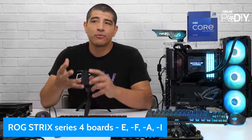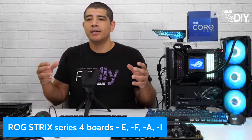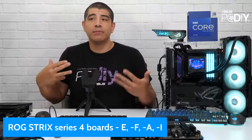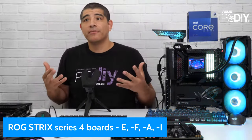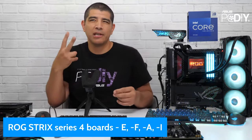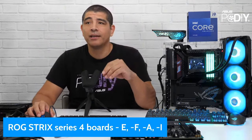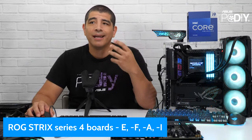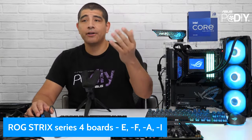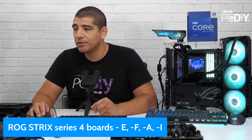But pretty much rank, density, population, and IC affect your memory scaling. And the less stressful that you make that configuration, the higher the actual scaling can be. And if you want to be able to get the best performance possible, it's going to be in a 1DPC, 1SPC based configuration. So essentially that means two DIMMs. So my recommendation for most gamers, if your focus is gaming, get like the 13600K and get anything from 6,000 to higher in terms of the MT divider on memory, especially with Raptor Lake, the scaling is quite good. So you could go quite high. Okay.